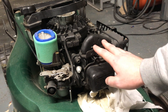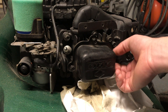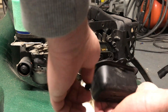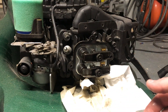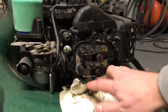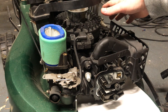This is a rocker cover, so it'll be an overhead valve engine if it's got this rocker cover on the front of it. The first thing to do is remove the rocker cover. It's a good idea to have a bit of rag to catch any excess oil from the rocker cover. There we can see it exposes the rocker arms, the push rods, and the valve springs. To make it easier to turn the engine over by hand, I've removed all the plastic covers off the top of the engine.